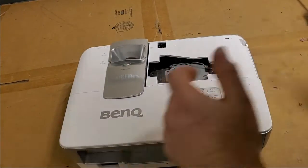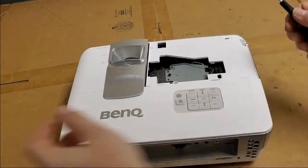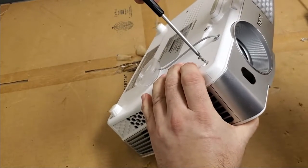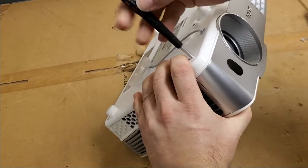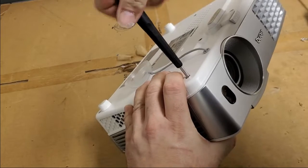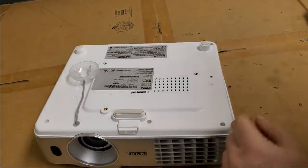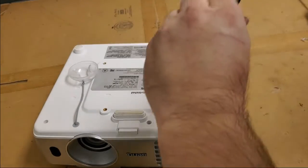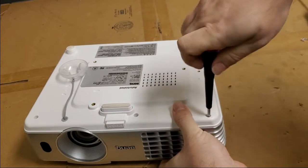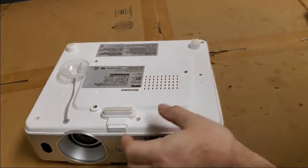All right, one. And then the screws in the bottom, I'm going to put in again by hand, since I did glue those screw towers. It'll just make it a little smoother, and it allows me to find the original thread and again not cut a new thread. So I just kind of rotate the screw backwards until I feel it drop. That's how I know when it's ready to run down the rest of the way.